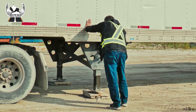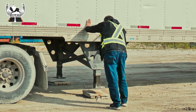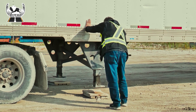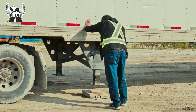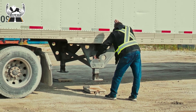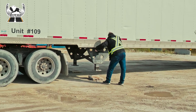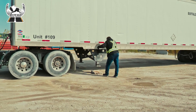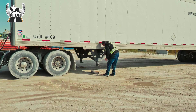Whenever you're rolling up dollies you want to make sure that you have three-point contact. Not so much in the summertime, but definitely in the wintertime, because you can slip and that dolly crank will sometimes hit you in the head, which is a compensation looking for a place to happen. Okay, my dolly pads are all the way up. I stow my handle.